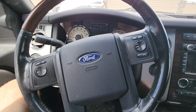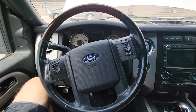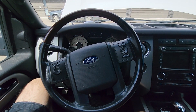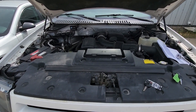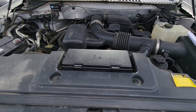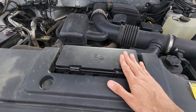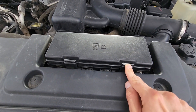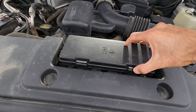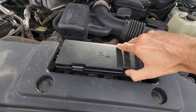This video will apply to Ford Expeditions made from 2009 all the way up to 2014. All the ABS fuses will be located in the main fuse box under the front hood which is right here — very easy accessible. To open the cover you will have two black tabs, one on the right side and one on the left side, so you want to press onto each of them to unlock it and lift up.